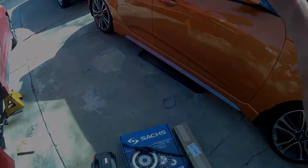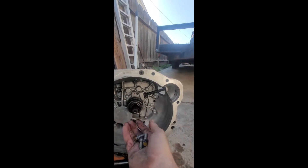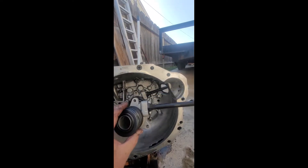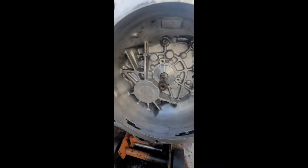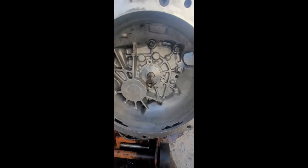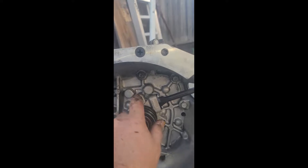I just pulled out the three 12mm bolts that hold the slave cylinder in. I have the new one here — these were red Loctite, so we'll be using red Loctite when we put it back together and torquing them to the correct specs. Now we're going to slide the old one out so we can slide the new one in. I went ahead and cleaned that up — got a little bit of dirt still there, so finish cleaning that all out. Got the new slave cylinder in, put some red Loctite on the bolts, and the next step is to torque them to 20 foot-pounds per the manual.